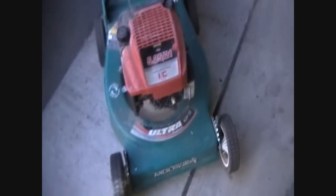I'll call the owner and see if they want anything else done. I just got off the phone with the customer and she says just put the cable on and she'll do the rest. The air filter isn't that dirty compared to some I've seen — you can still see light through it — it's just beat up on the sides and the foam doesn't seal well, but it's not my machine. The plug's pretty carboned up and it's low on oil, but she said don't do anything about it. So I'm going to put this back together, finish putting that cable on, and wash it.